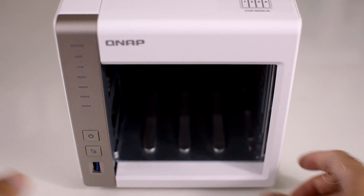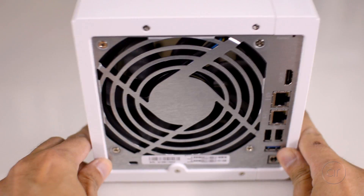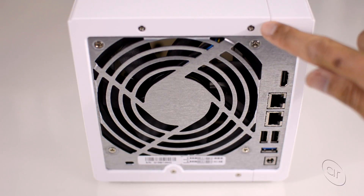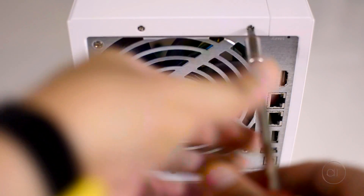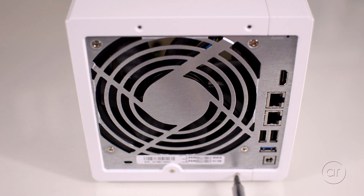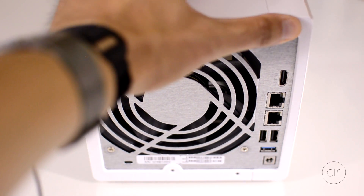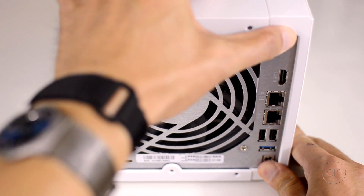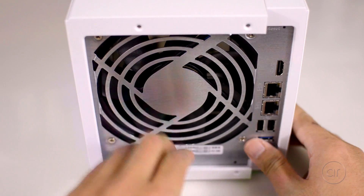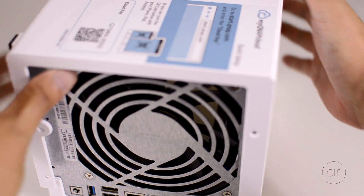You'll see the chassis is empty, and you can see the faint trace of a motherboard as you peer down the hole. Flip the case around. These are the four screws that you'll need to remove. As I'm taking out the screws, you'll notice I'm wearing an anti-static wrist strap, which I highly recommend when opening up any type of computer so that you're grounded before touching any electronics. The case itself is made of two plastic pieces. There's a seam on the right side that marks the place where the two pieces come together.